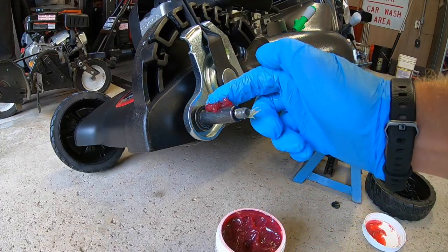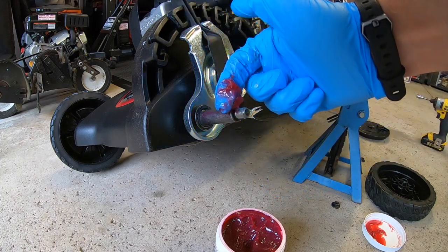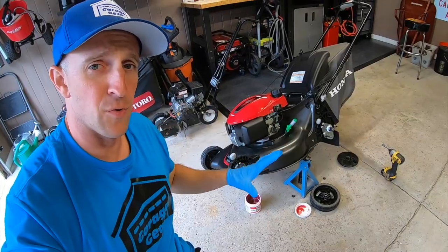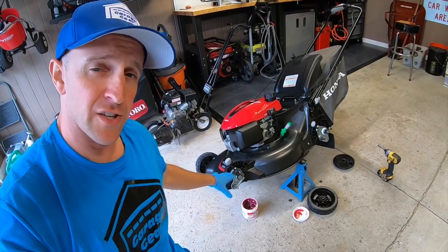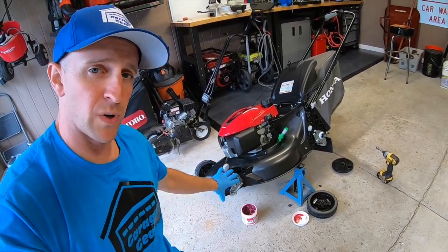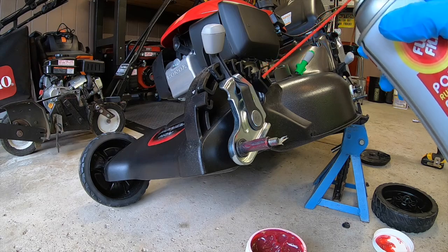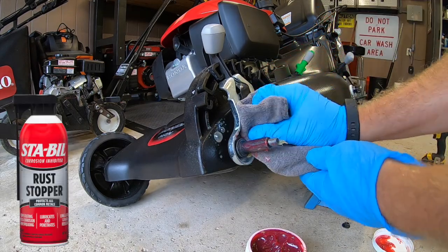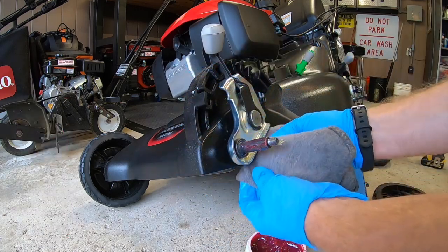We're just going to take a little bit on our finger and spread it across the wheel shaft. Remember, a thin amount wins — thin wins, thick sticks. So lay it on thin, that's all you'll need. Now, if you remember back to the last video where I rust-proofed the entire lawnmower, I avoided doing the height adjusters because they were hard to get to with the wheels in their way. What I'm going to do now is spray down this height adjuster with a little Fluid Film — you could even use Stable Rust Stopper — and then wipe all around and work that stuff in. Thin wins, thick sticks, so put it on thin.